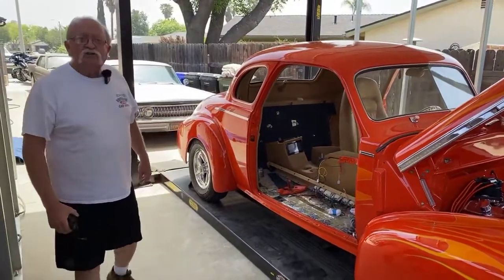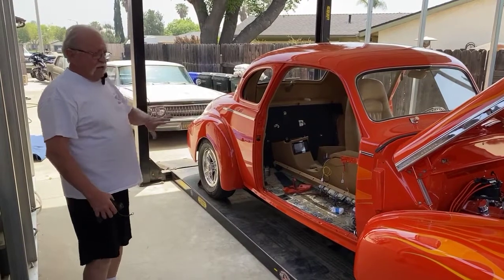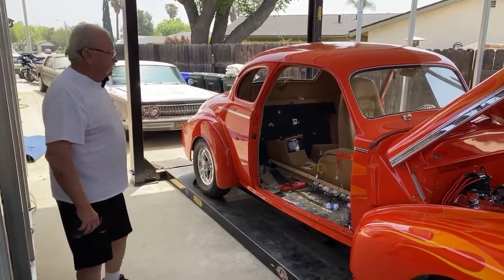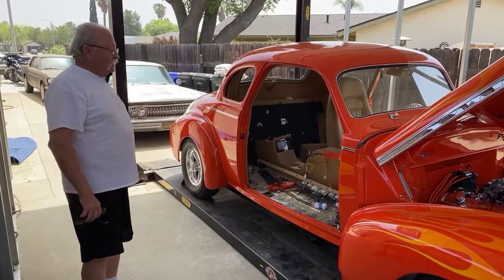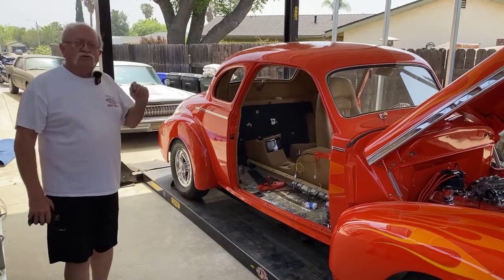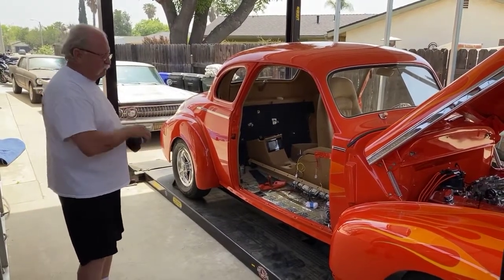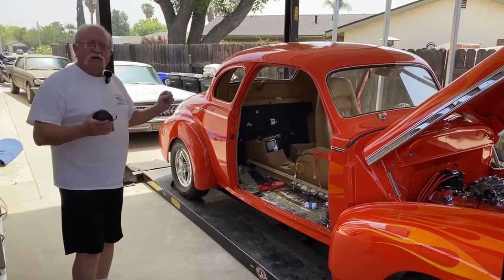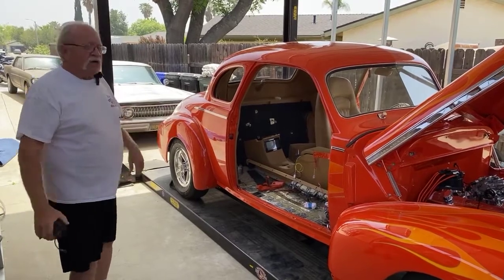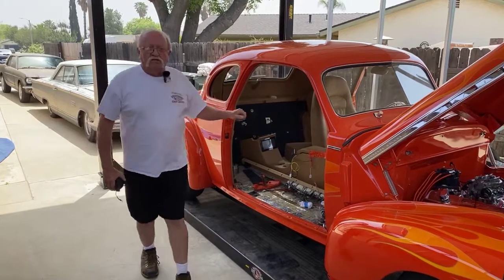He says, because things are going to settle. So any of you that are going to do body mounts, I took this out. It had no front end on it, but it had the radiator and everything. And I drove it around Altaloma here for, I don't know, half hour or so. Brought it back up, threw it up on the four post here, and sure enough, those doors had settled. Yeah. And so I had to get back under here, and I think I used 1 or 2 shims on each side, little shims just to bring it up. And then I drove it again, and I kept doing that till it didn't settle anymore. Yeah. And those doors, you can take them up like this and just push them with your thumb, and they close and latch. They're dead on.